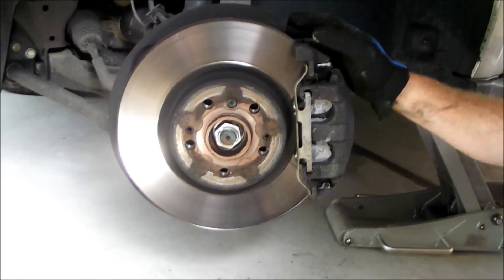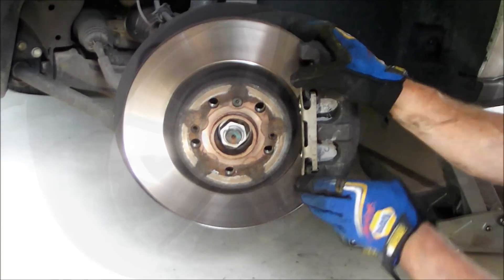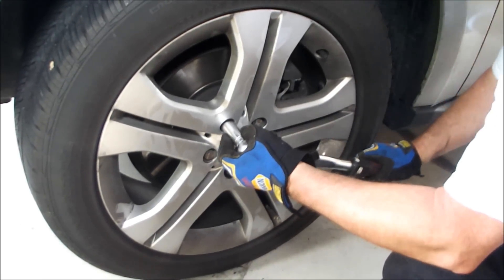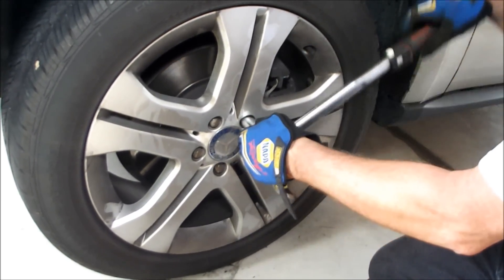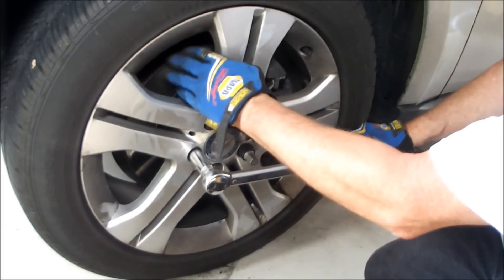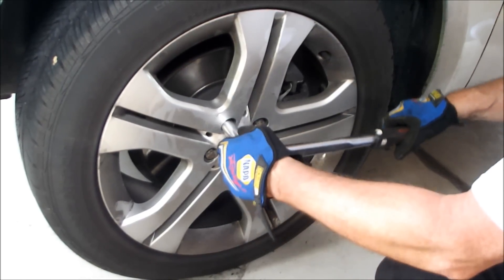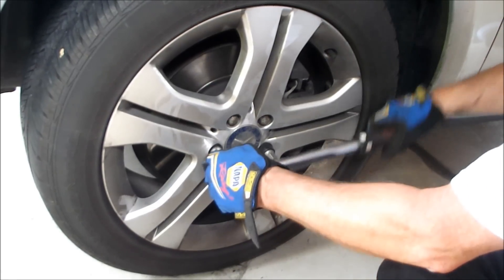Click — and again, check it to make sure you don't want it falling off. Your customer will not be happy if it is. Always remember to torque the wheels: get the specification out of the manual or online, use a good quality torque wrench, and use a star pattern. Always torque the wheels — otherwise you could warp the rotor or break a bolt with an air gun. It's the correct thing to do.